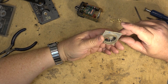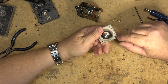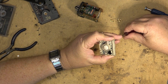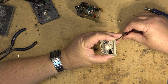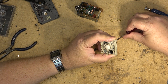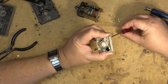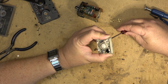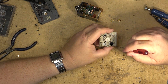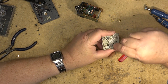What I'm trying to fix is the hour/minute selection, which is controlled by this control over here. When I turn this one you'll see there's a little catch in there that turns this gear — every rotation it clicks it a quarter of a turn like that. But on this one when you turn it, nothing happens. I think the little catch is broken, and you can't even rotate this thing manually because it's kind of locked out.